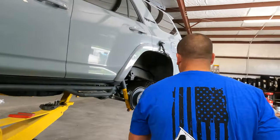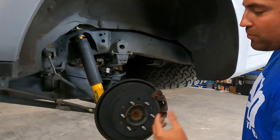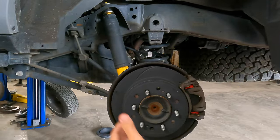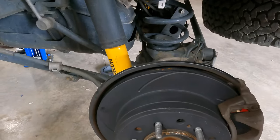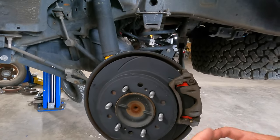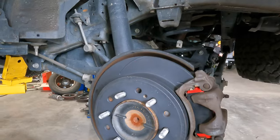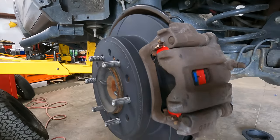If you follow me to the back, you can see the rear rotor and pad upgrade. You get your slotted Powerbrake rotor in the rear, again with the same venting as OE. You're not necessarily increasing the venting like you would in a Stage 1 big brake kit, but the quality of this rotor is significantly better. It goes into the compound of how it's made in the foundry. And then you can see the brake pad upgrade in the rear as well.